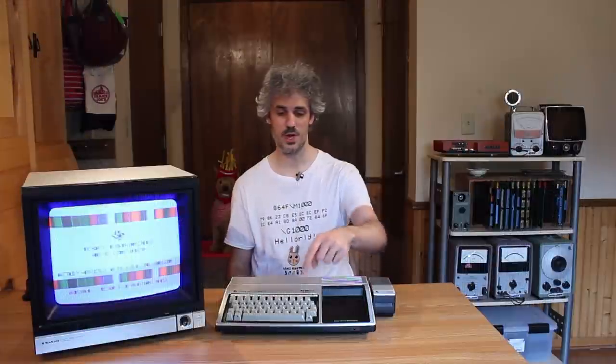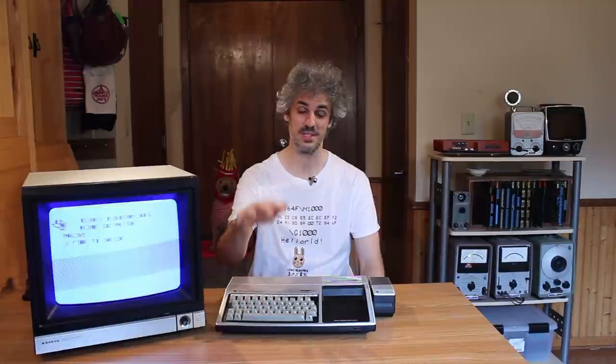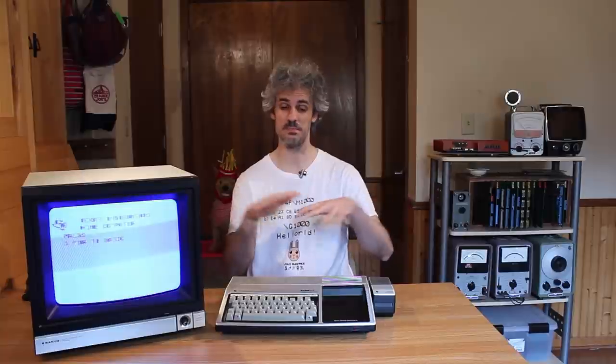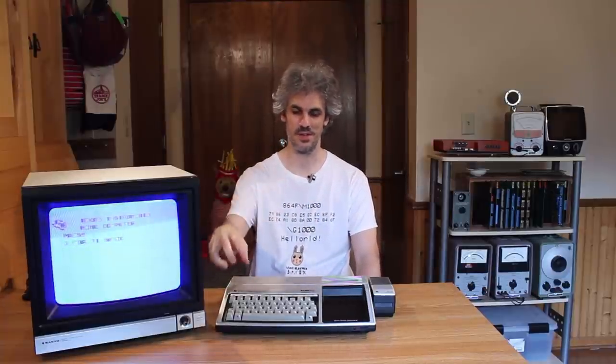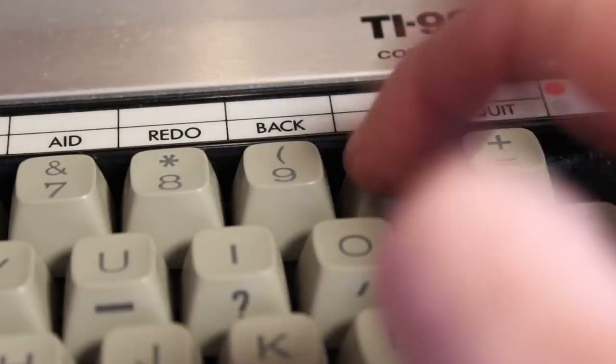The other issue you saw was that my keyboard here is sticking, and you may also have noticed that the keyboard is a white keyboard instead of the black keyboard it should be. When I got this system, it had the black keyboard in it, but it was a membrane keyboard and it was totally thrashed. So I found this white mechanical keyboard on eBay, bought it, threw it in, and it works perfectly, but I got the alignment not quite right. So this top row of keys jams up against the case and they don't return.